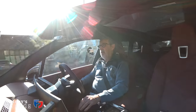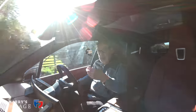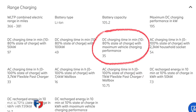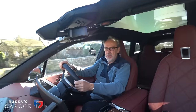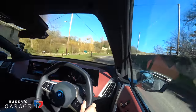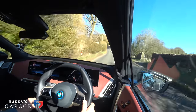You can't come home after a weekend away with a very low battery, plug into your best supply and expect a full battery by 7am. You'll probably only be at 50%, or you have to use a fast charger away from home. The maximum fast charge rate is 195 kW — from 10% to 80% takes 35 minutes — but there aren't that many chargers in the UK that can deliver that.